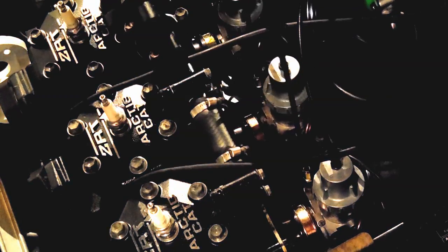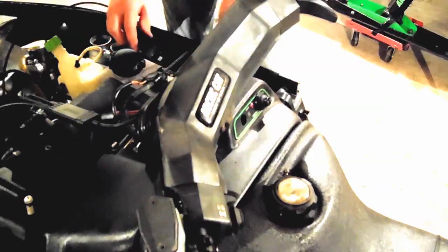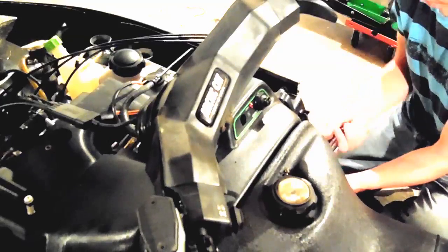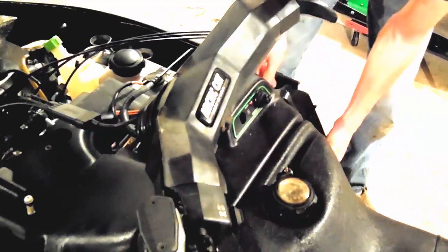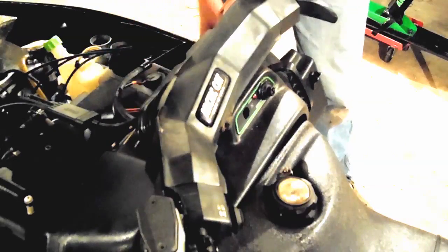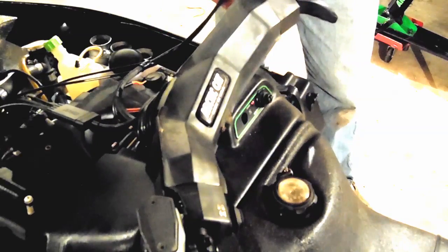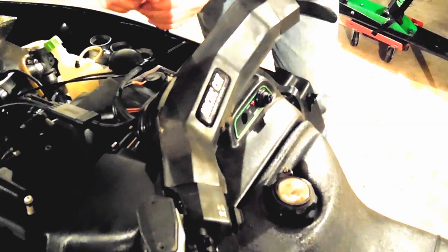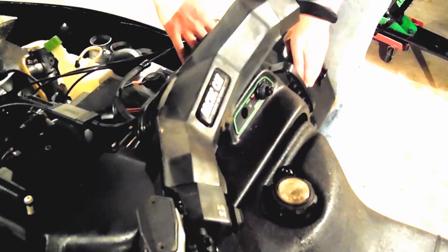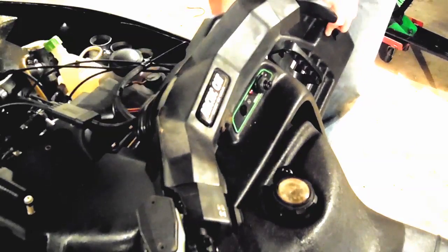So now we can install this into the dash. Take the two Phillips screws out of the dash here, take this off down here, and the dash pops off. Now you want to go under the brake line and over the top of the bar. Before that, just take your brake lever and flip it open, and take your plastic nut off the end. There's a flat side on the choke cable and a flat side in the hole there — make sure you get it lined up, so it's a little bit easier to put in.